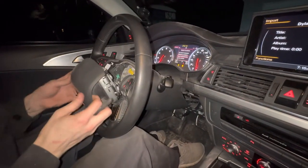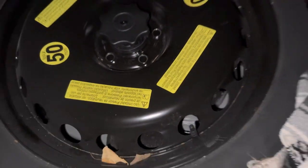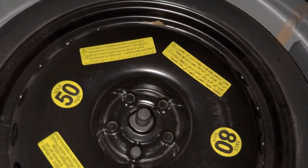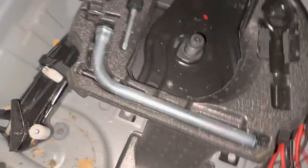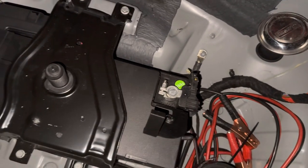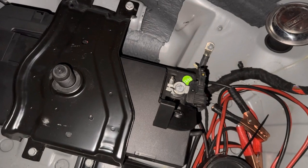Now you can put it back straight, and at this point you need to disconnect your battery. To disconnect the battery, pull your spare tire out — it's just this cap here, twist it, take that out, and lift your spare out. Then you can access the battery. Pull the foam piece off, get a 10 millimeter, and pull the negative terminal off, swinging it to the side. That way the car has no power and you won't have any issues with the airbags.